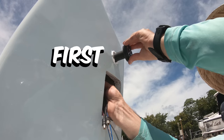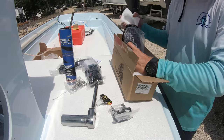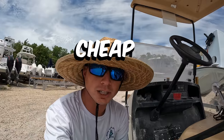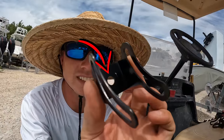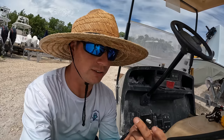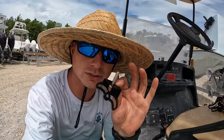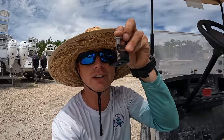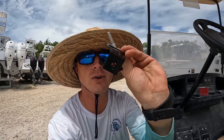To start wiring, we first mount all the components. Here's the problem with cheap lights — you see the way that thing sticks in there, that's what locks it in. If you've got anything that's longer than this, this won't work. So now I've got this bracket and a bolt that will lock in with those pieces. Now it won't fit in here, so we've got to drill that hole out.